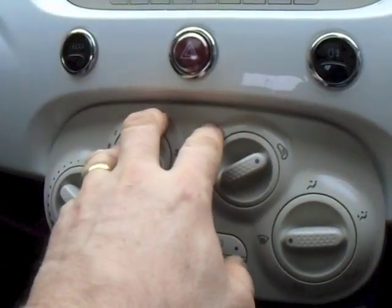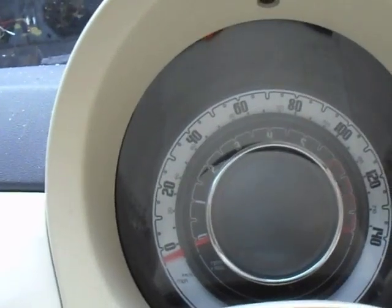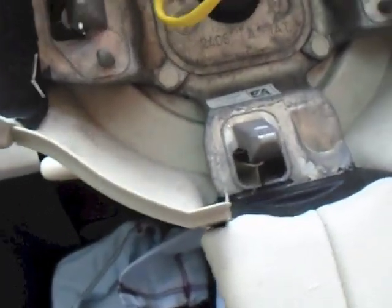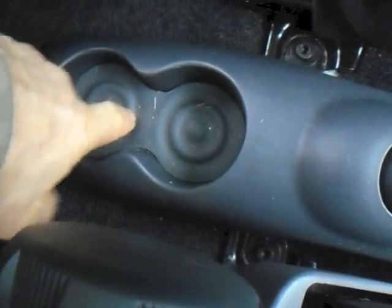The first thing I've got to do is get this panel off — I've undone the screws along there. Then get the stereo out, then take this off. There are a couple of screws here and there. The steering wheel needs to come off — obviously the airbag has gone under this rubber knob here. The speedo needs to come out. The top and bottom cowlings need to come off, which are quite awkward; the screws are in awkward places. The centre console needs to come off — there are two bolts underneath, a bolt underneath there, and then more bolts. That all lifts off. The bottom piece comes off, the kick panel comes off.